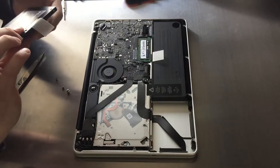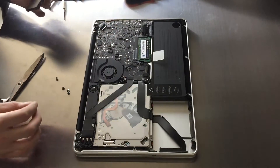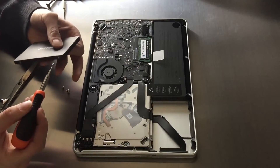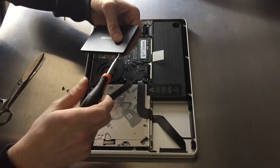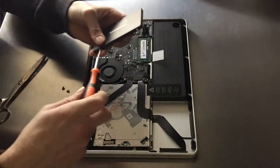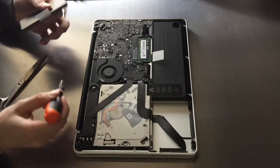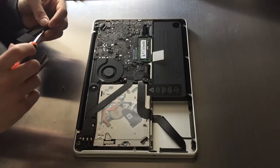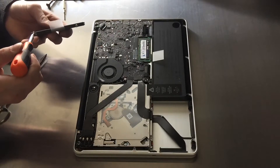Now take the little plastic tab that you just got off the hard disk and put that back on the SSD, so if you ever need to get it out again you can easily pull that little tab. Next, put those screws that we just got off the hard disk onto the SSD — because if you don't, you're going to have a loose SSD in your computer. I'm using the Torx screwdriver from Scandia. It will be linked in the description below, or something similar from Amazon. Of course the SSD is also linked down below.